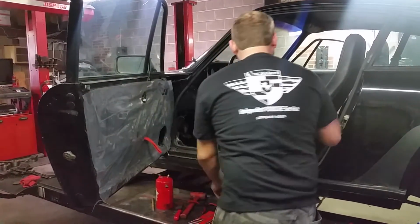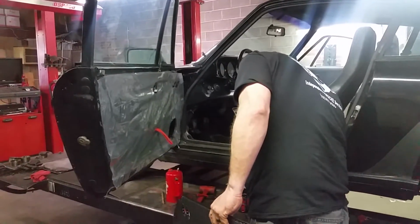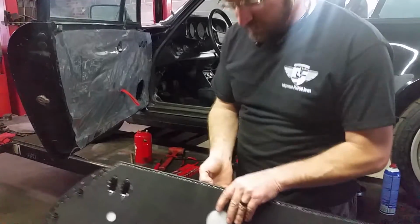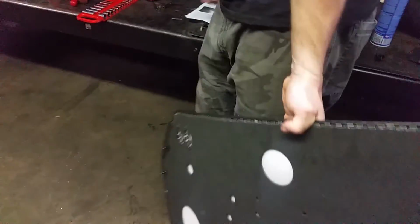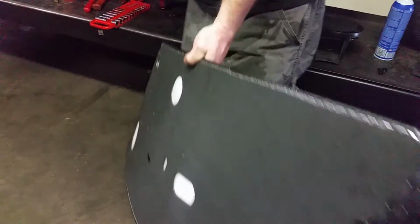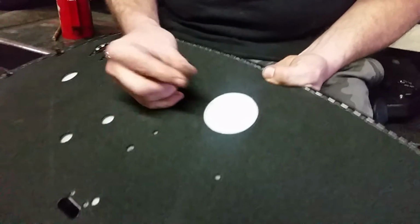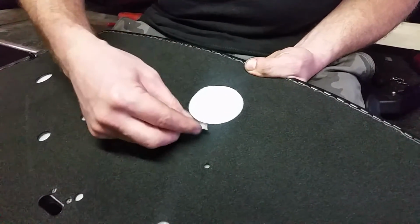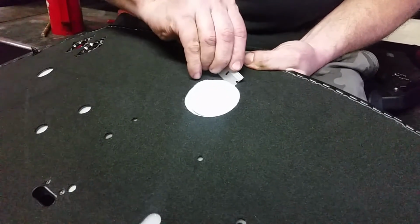So the next thing you're gonna do is prep your door panel, all right, for your accessories. And what I would recommend, one of the first things that you do is, if you have this style door lock, push it into it like that and make it stick up, and then go around with your razor blade. Remember what your mom told you, cut away from yourself. All right, and you're just gonna cut out that inside panel piece for the lock, okay? Here I'm cutting towards myself.